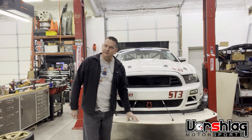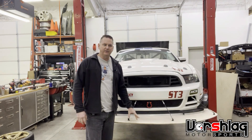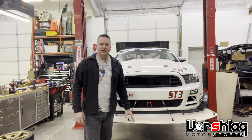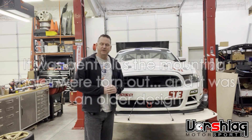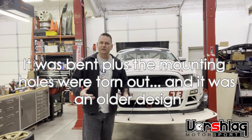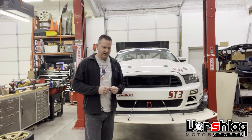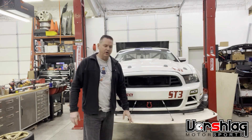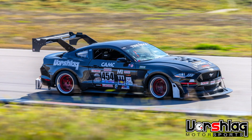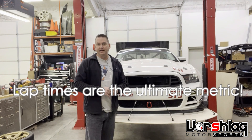The aluminum material is very expensive, and it does get bent. This car had the same splitter knocked off three times, and we were always able to put it back on. But the third time it bent it pretty badly and we couldn't reuse it. We also learned a lot — that was a splitter we built 12 years ago, and we weren't using tunnels then. We weren't maximizing the forward extension, and we found with testing on other cars that the more forward extension we get, the more downforce we can make — we can feel that in aero balance and lap times.